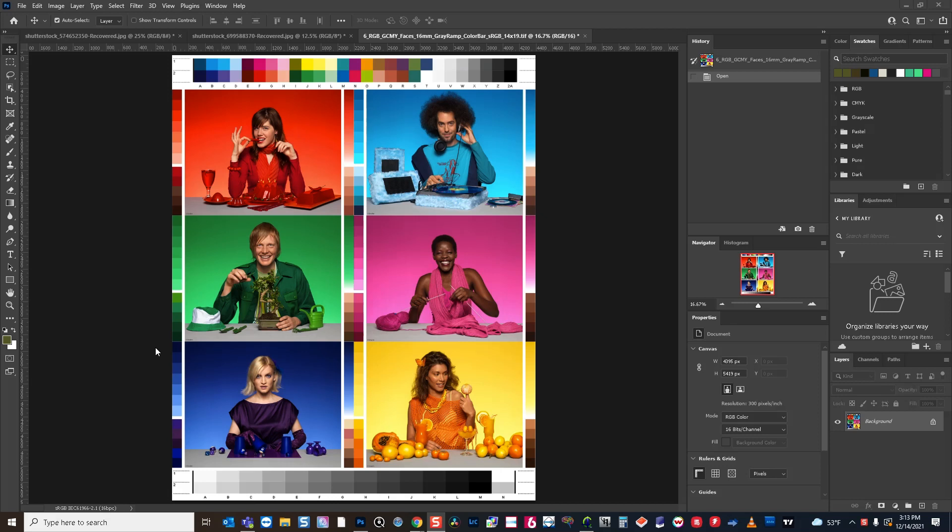Hello, my name is Jim Ami and I'm the color specialist here at IT Supplies. Today I'm going to go over how to use the print settings for the Epson F170 dye sublimation printer. We're going to be using Photoshop, though you can use something like CorelDRAW or Lightroom. Most photo applications utilize the Adobe color engine, or Corel has their own color engine, and these will be a little bit more accurate than printing out of something like the simple Windows picture viewer or the regular Photos app on a Mac. The reason is you're going to use the Adobe color engine as opposed to the Windows or Apple color engine — it's going to be a little bit more accurate.